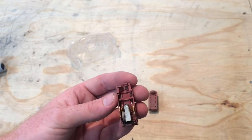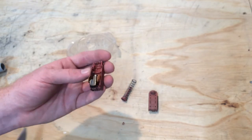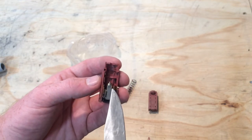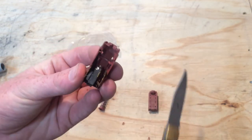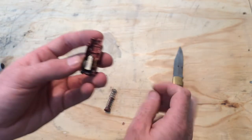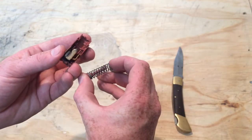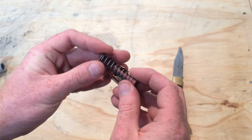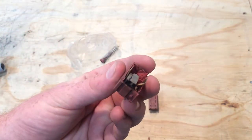So this is all that's inside it: we have two contacts coming through, we have a little PTC puck — the heating element — and then a little solenoid body full of wax. The electricity flows through the wax actuator itself, which just acts as a conductor. There's a little pin at the top that will extend out by about four or five millimeters once it's hot. It's a sealed chamber of wax — when you heat up the wax it expands and pushes the plunger up with quite a bit of force, which is why it works well for this valve. A strong spring returns it once it has cooled down.